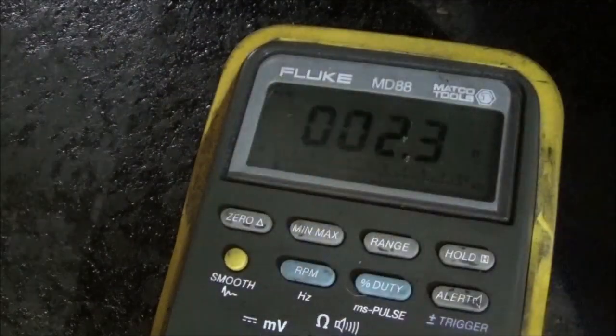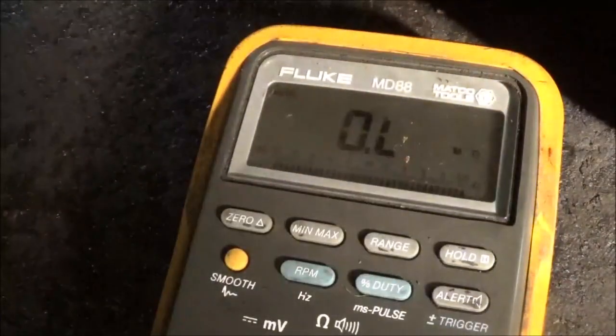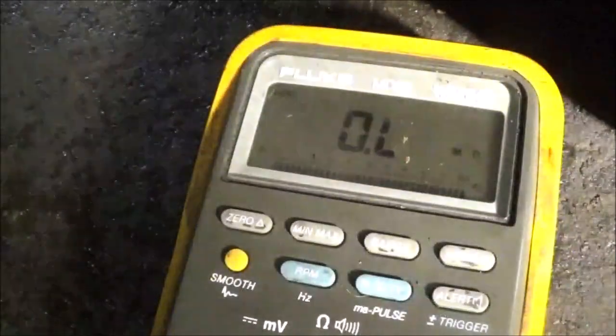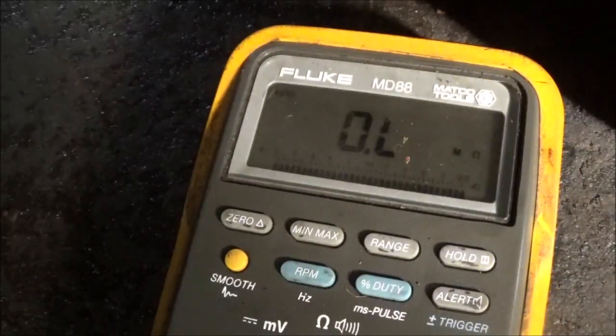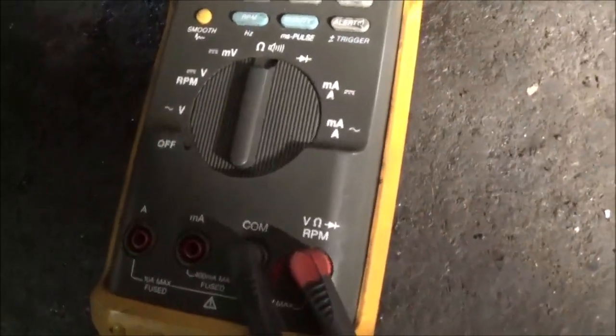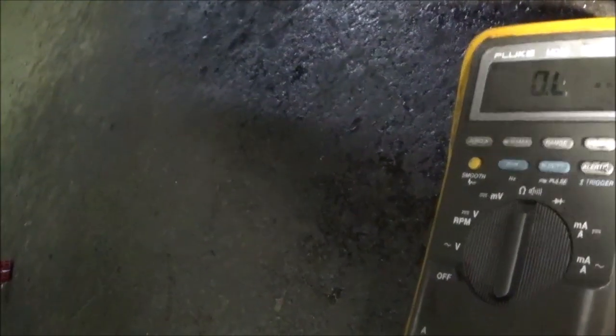It's not showing a problem. All the other solenoids are that range, 2.4, 2.5. Now there's something I'm going to do, and this idea was told to me before. I forgot about it and was reminded by Mr. Jerry Gott, ATSG. So I'm going to try it, and I'll show you what that is.